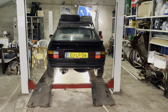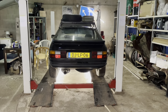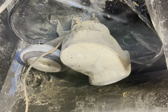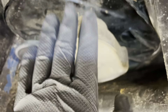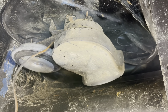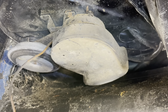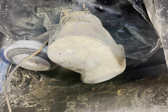Let's get that horn working — it's the last thing I need to do to get this car road-worthy. The first step is to remove both of the old horns. I tried them with 12 volt directly on the contacts and nothing happened, so I think they both just died. I'll mount the new horns, get them installed, and then start chasing back the wires to see where it's not making contact.